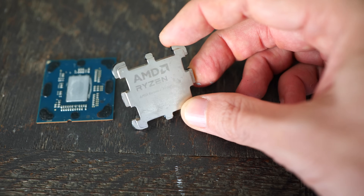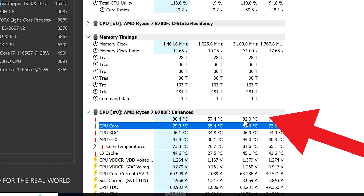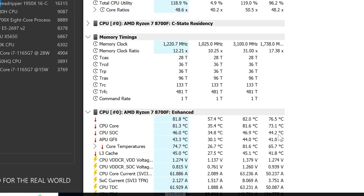I don't know any tech enthusiasts that want thermal paste between the die and the IHS — well, they're usually enthusiast overclockers who use direct die cooling. But the majority of people want an IHS that's soldered to the die for the best temperatures possible. Because after I did the de-lid and then put on just some banger GD900 thermal paste — which is like $5 a tube off AliExpress — I got a temperature drop of 13 degrees in the same benchmark. 13 degrees. Not to mention the gaming performance was also slightly better, and we were getting slightly higher megahertz boost in games too.